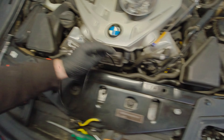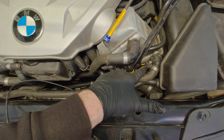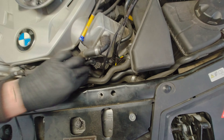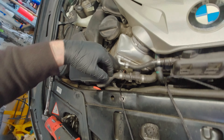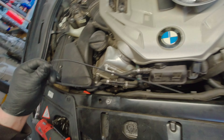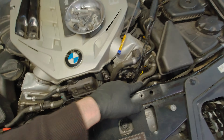So I'm going to tuck this away and make it look nice. You connect one side into the T-map and then the original T-map connector plugs on the other side. We'll tuck it away and zip tie it so it doesn't end up touching any heat. Same thing on the opposite side. The coloring is literally just to designate which side of the engine, but if one's short and the other's long and they don't reach, you're going to have to use your brain a little bit.